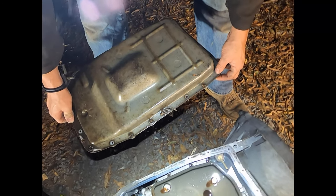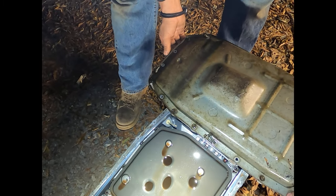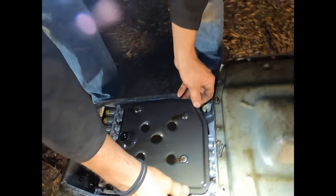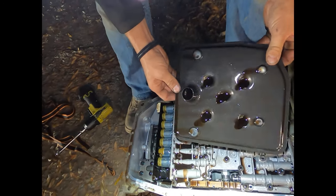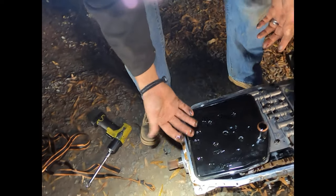That is the filter I'm looking for — that's what the other one was missing. So we'll pop this off from that pickup tube right there, flip it over, drain as much of that fluid as we can back into the casing, and grab some towels and clean it off before putting in another one.